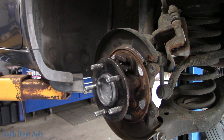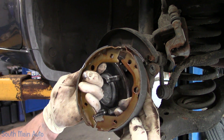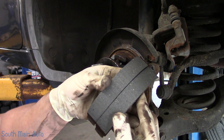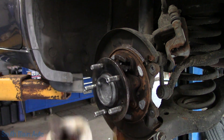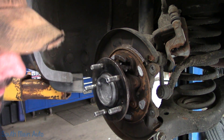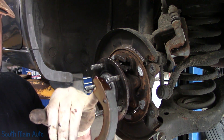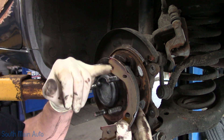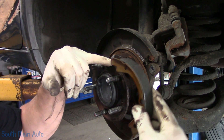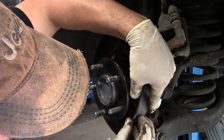Let me go get our new shoes. So the shoes are actually the same — as I said, you've got some Beck Arnleys. Just line them up, make sure the friction material is the same. Usually park and brake shoes are, but I'm sure there are some instances where they are not. You can see the difference between the top and the bottom — the top is going to sit on where it pivots, and then the actuator is going to go in there.